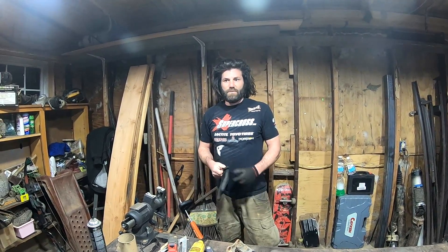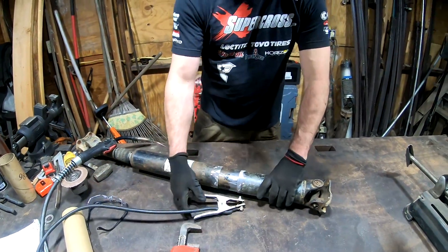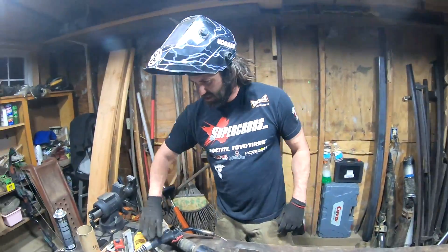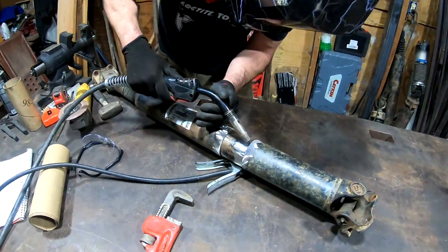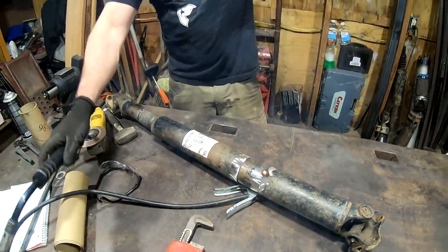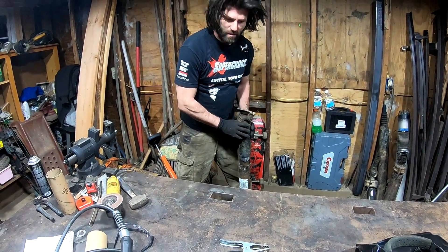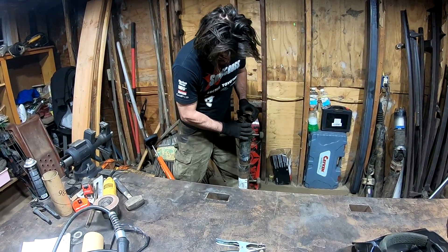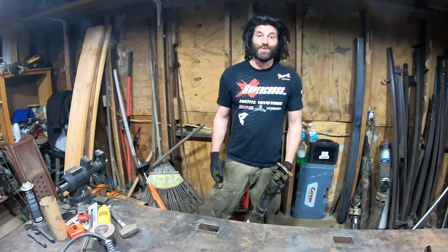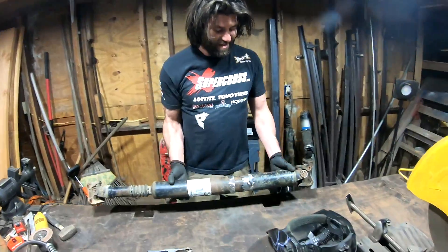We're at 17%. We're going to tack this on here. That should be enough really. Bear says flip it 180 — because you'll have a more solid piece instead of the slip joint. Bear is two for two. I'm going to tack this in three places now because that's going to pull itself — tack it up, flip it, rub it down.